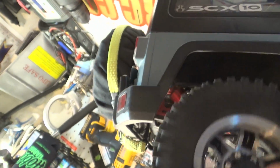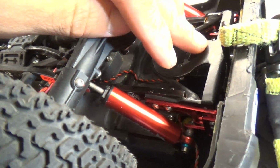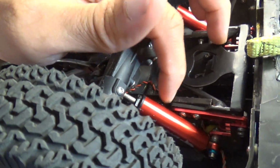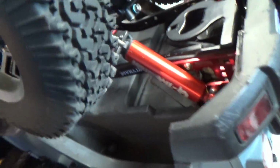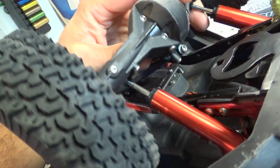So what I did is I took an Axial Racing SCX10 chassis and I chopped it short. Used this rear bumper mount here from Wordy made, added that, then I added these shock tabs here and got the position that I liked for the shocks. Make sure I had nice travel, make sure everything functioned properly like it should. And it does. It works great.